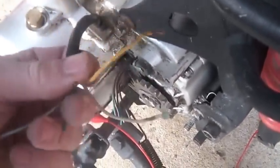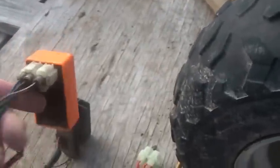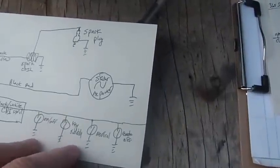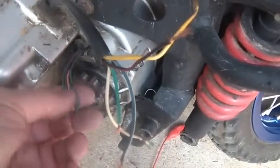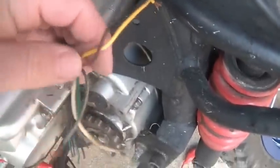I've got my white, yellow, black and red, blue and white, and green for ground — those are all important. Some of you see additional wires and go crazy: those wires indicate if you're in neutral, and there's typically a little dashboard display. There are also some interlock wires, which may be why the harness is so large. But the ones involved with the transmission — I am not hooking them up, I'm ignoring those. These are the ones that matter to me.